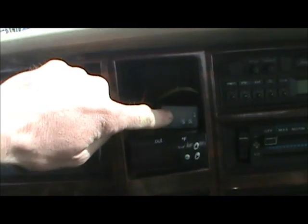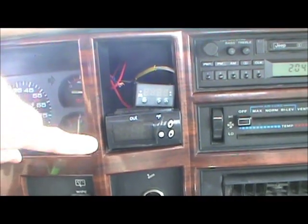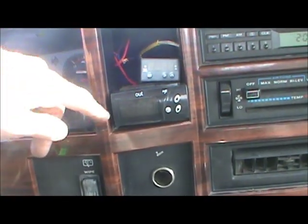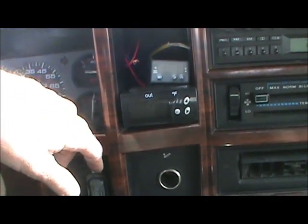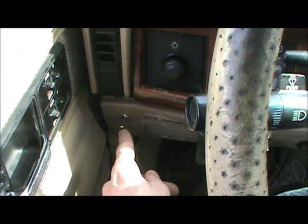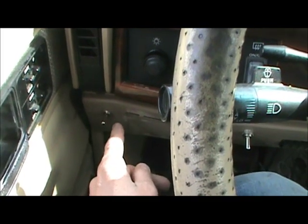But this right here, these are gauges. They're thermostats that I have. This little one right here at the top, I have a sensor connected to my spark plug to read the cylinder head temperature. When I ordered it, I got it in and it didn't work from the get-go, so I gotta get a new one of those. This one does work. I don't have power connected to it right now because I'm bypassing it so that I can just manually control that solenoid valve for the exhaust by flipping that switch down there. So that one's to the exhaust, and the solenoid and float switch for my vaporizer container.